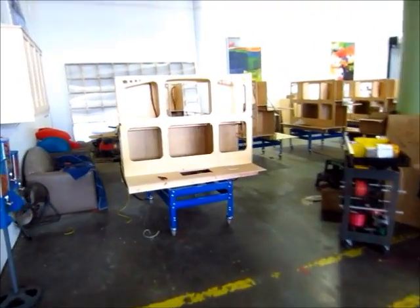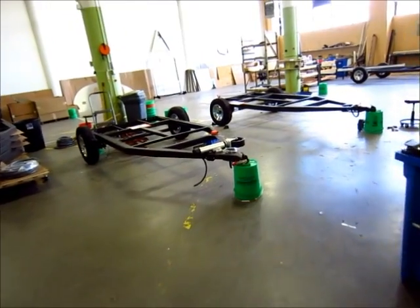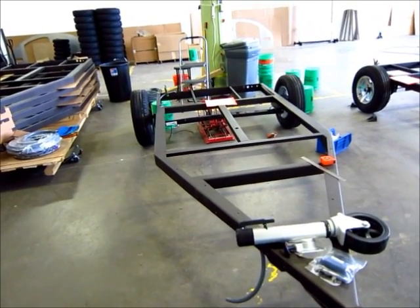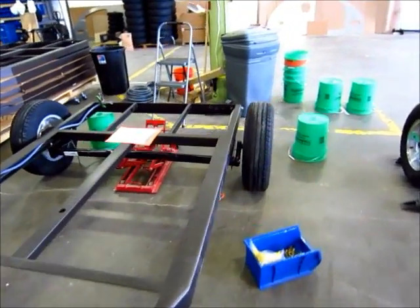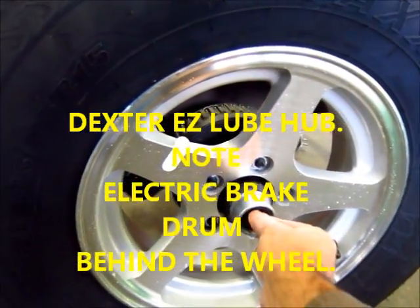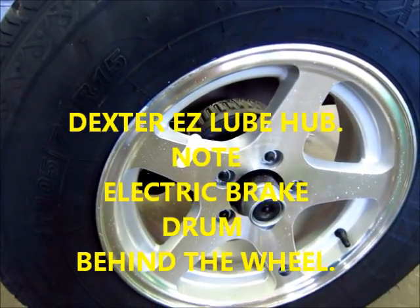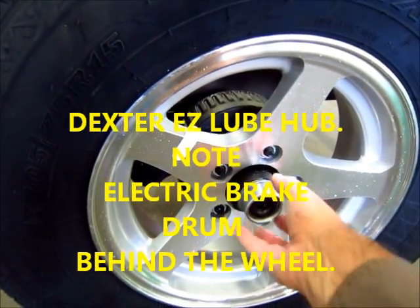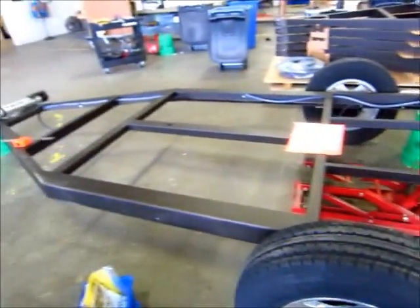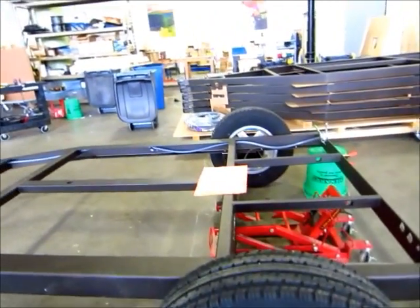So this is the production here - I've never seen this. Over here you can see the frames and the axles. The frame is much beefier than I remember - it's minimal as I can imagine it being and still be strong. And your Dexter axles, right? This is a Dexter torsion axle. And you still use the lube system - easy lube. You pop this rubber divot out and there's a cork and a zerk, a grease nipple. You just shoot in the grease and it back-flows. The first time I greased mine it took almost a whole tube to fill it up. And now when I put in a few pumps, it flushes out the old grease.